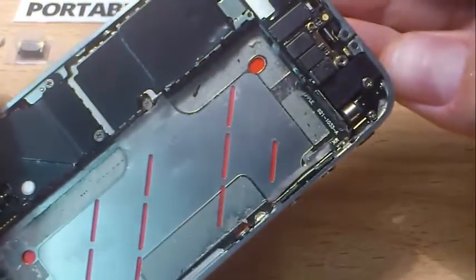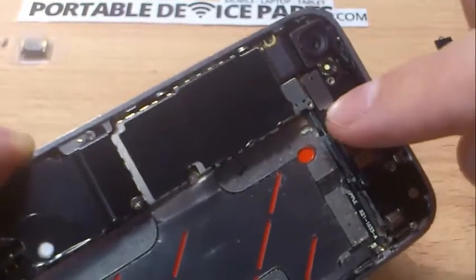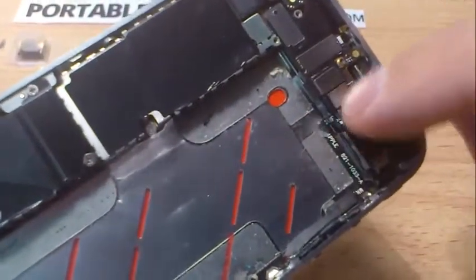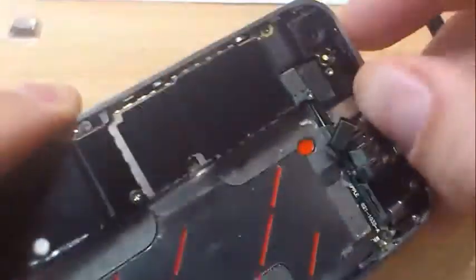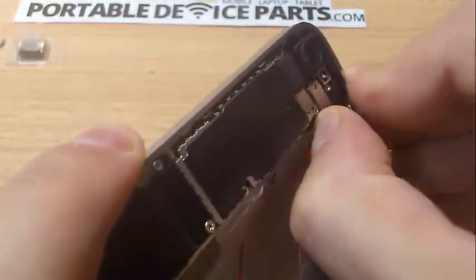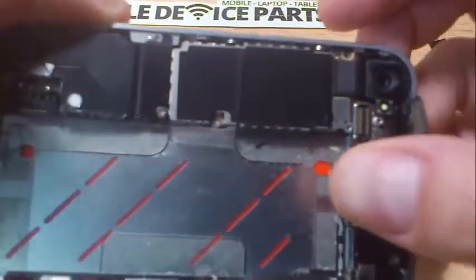What you're going to see is three cable connectors and two main ones. These two main ones connect to the LCD screen — when you change the LCD screen, you take them up. These just connect to the logic board. I prefer to undo all the cable connectors: you go one, two, three. We lift this one up and this one up. Certain people have certain orders, but we just lift these off — it's pretty simple like that.